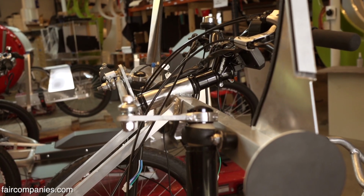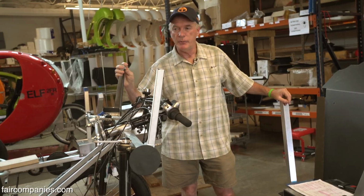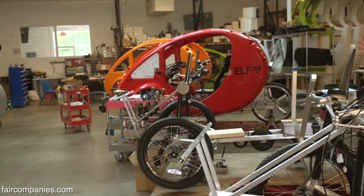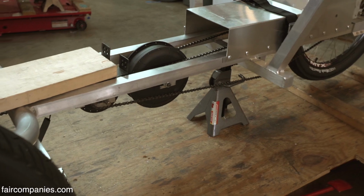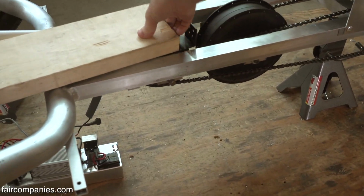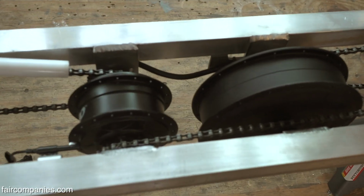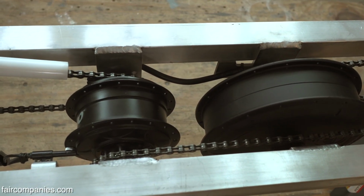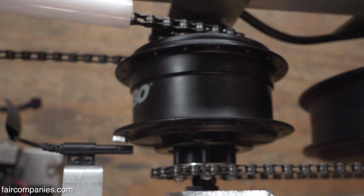But everything like a kayak or like a light aircraft is really, really about efficiency. The kayak part is mostly about the body. The frame part is more like aircraft. We do use some electrical components that would be like from the RC industry, remote control industry, the small electric motors, the controllers, things like that. That's a continuously variable transmission, and that's a DC, a super efficient motor. That's 1 horsepower, 750 watts.